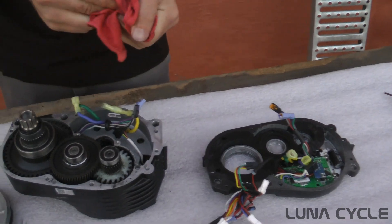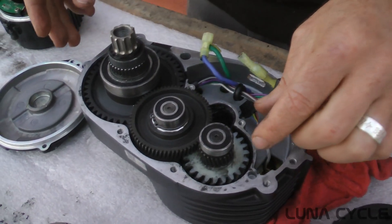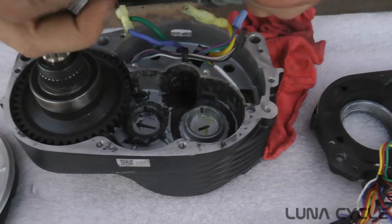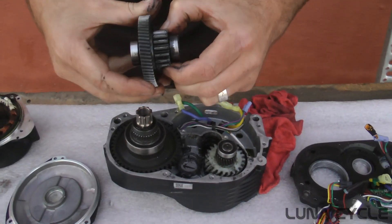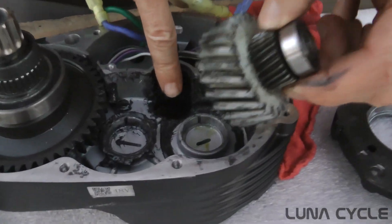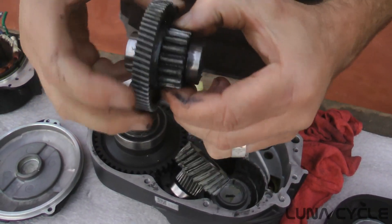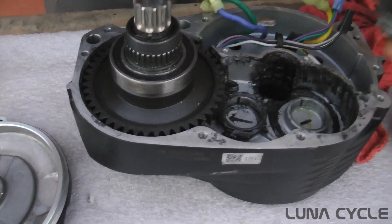Once you've got that cover off you've got all your gears. Once the cover's off you just pull these two out together — it's just a couple of bearings that sit down in the housing. There's no longer a one-way bearing in the nylon gear; now there's a one-way bearing built in over here. Basically your rotor drives the nylon gear, which spins another gear on the same shaft, that gear then spins this gear, and in between these two you've got your one-way clutch, and then this one drives the main gear. Pretty simple.